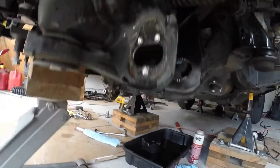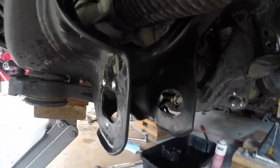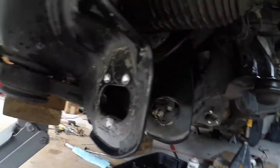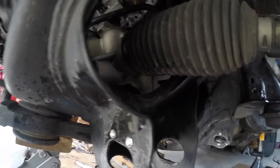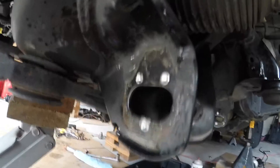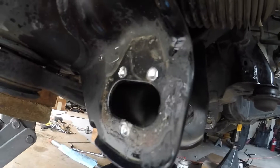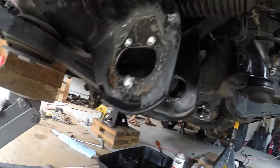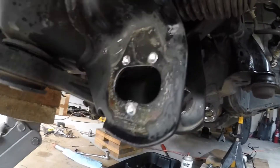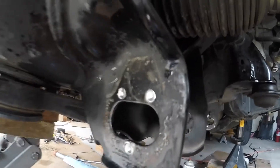I have the tabs off here. I want to point out I went a little bit further than I probably should have, but that's what it may look like. Those welds span outwards so those things were on there pretty good. I'm going to grind this flush, and anywhere where it went too deep I'm going to put a fillet weld in there and then grind that off so it is just flat metal — that way there's nothing that can get in there and start to pit and deteriorate from the inside out.